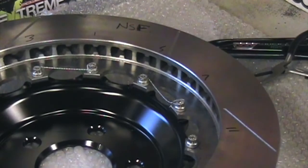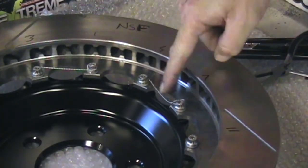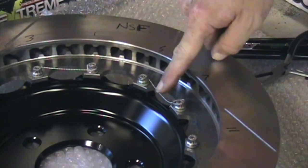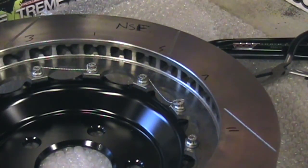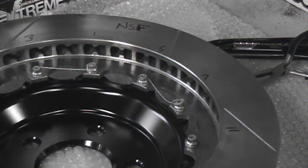That's it — that's now lock wired, and you can see it's tensioned up. Even though it looked a bit slack before, it has tensioned up now. So that's the way to lock wire a wheel disc. I've got another four to go, but I hope that helps any of you out who are thinking of upgrading your brake rotors on your Mustang. Cheers guys!